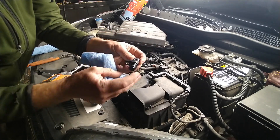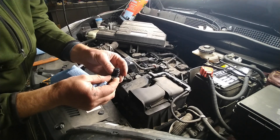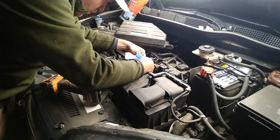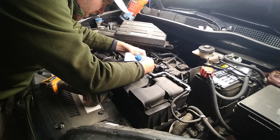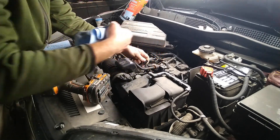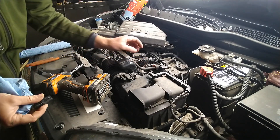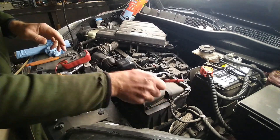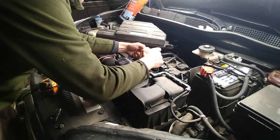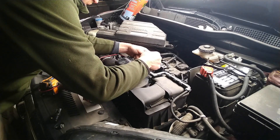Here we've got the sensor — it's a small unit, three-wire. We've got a red wire, a white wire, and a green wire. I don't know the pin-out off-hand, so what I'm going to do is turn on the vehicle, get a voltage meter, and test these pins to see what voltage we have. I've pressed the ignition button twice, and I've got my probes on the center wire and the red wire.